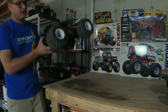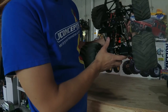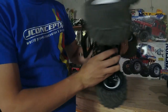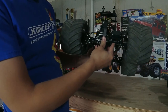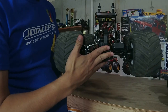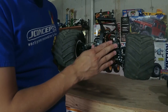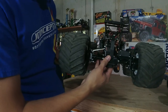One of the other things with these mod clod trucks — you might have seen the acronym BTA steering. That just means behind the axle. You could run it forward if you wanted, but the reason everyone uses BTA is it's safer. You guys have seen some of the crazy abuse these things take. The gear case is a heck of a lot tougher than your steering arm, and the steering arm goes right down to the servo. Many of us are running nice servos on these things so they can turn the big wheels, and BTA protects your servo.